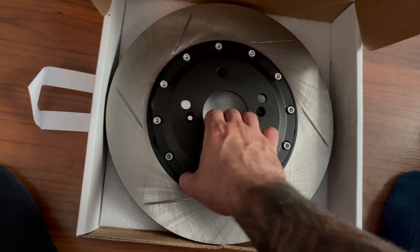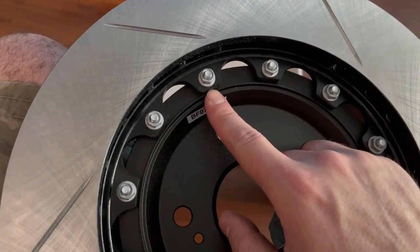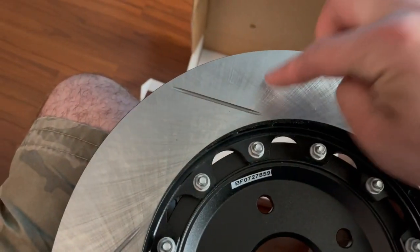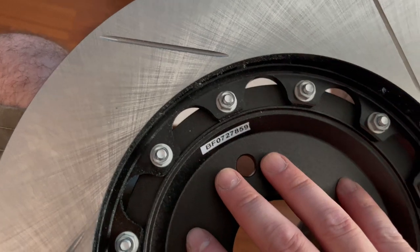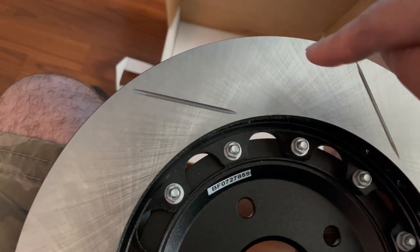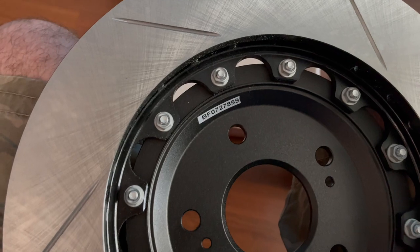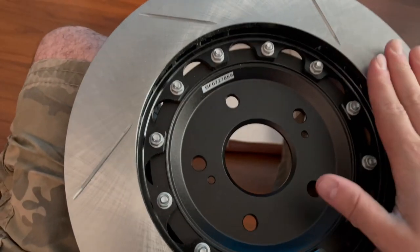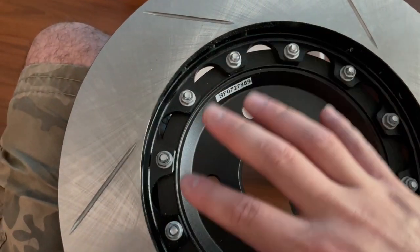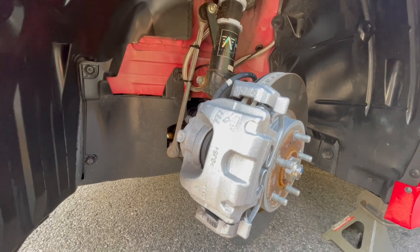Look at that — beautiful right side brake rotor, and it's not that bad in weight. As you can see, these rotors are two-piece. You take out these bolts and the outer ring separates from the center. When doing maintenance you're disposing of and replacing the outer ring — the center hat you always keep. You can clean it up, paint it if it gets rusty, whatever you want. The rotor surface is replaceable; the hat you keep.